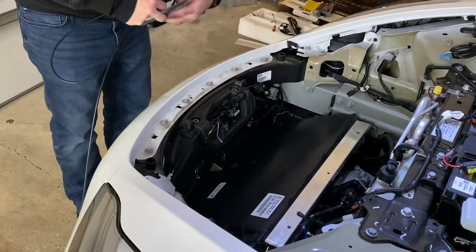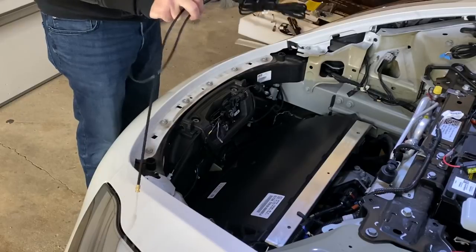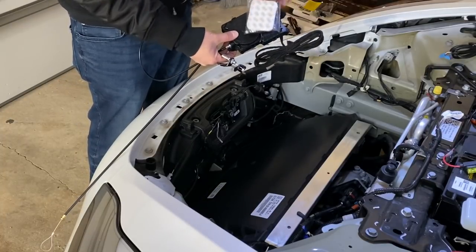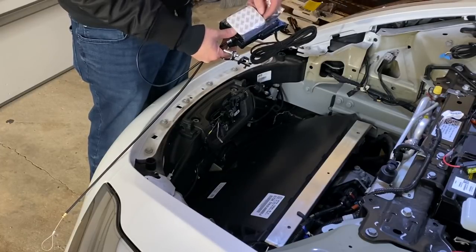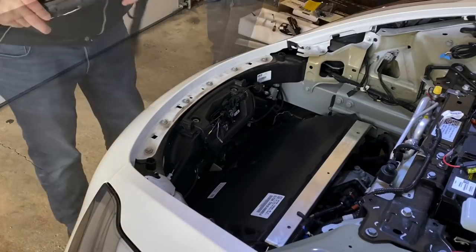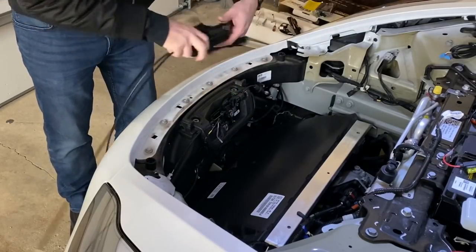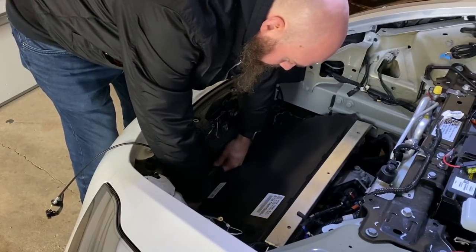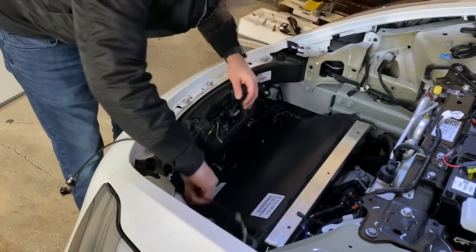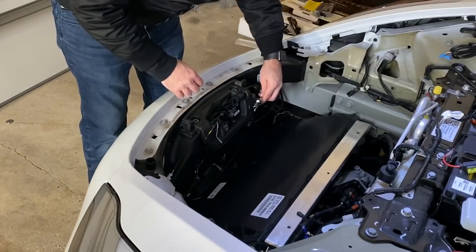Before we replace this spring, we are going to install the little motor that does the soft close of the latch. I'm going to find a place down here somewhere. It's not a very smooth surface to put a lot of double-sided tape, but the kit does come with 3M double-sided tape. I did make sure I used an alcohol wipe to clean off all dirt and dust just so this will adhere much easier down here. I'm just going to place this down out of the way right around here, so I can route the latching mechanism up over here.